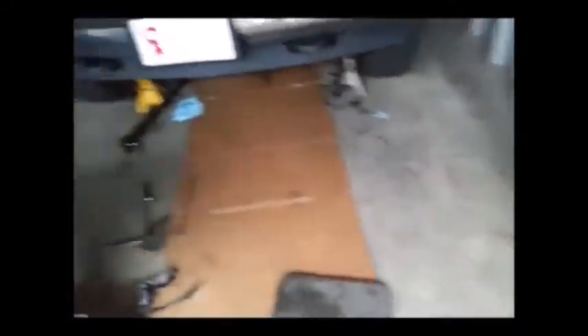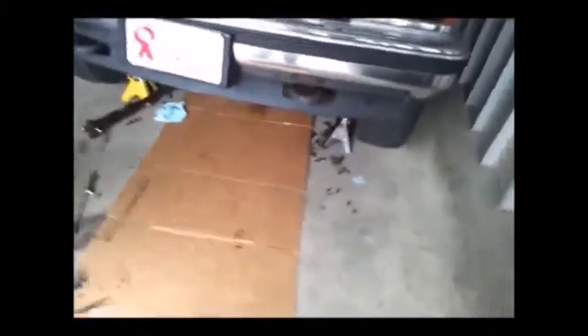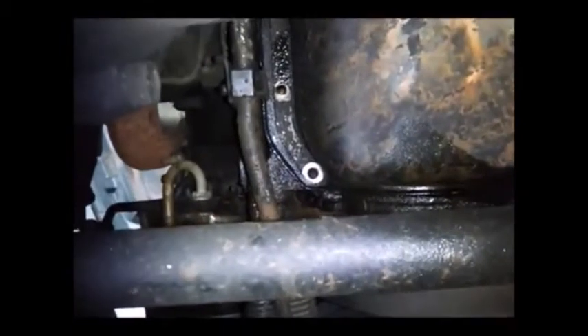What I'm doing now is I plan to replace the rear main seal, but I can't get the rear main seal off without dropping the oil pan - at least I don't believe I can. To drop the oil pan, the bolt up front is a 12mm, the bolt there is also a 12mm, and the rest of them are 10mm. I thought it was going to be a pain to get to the bolts on the other side of this front differential.